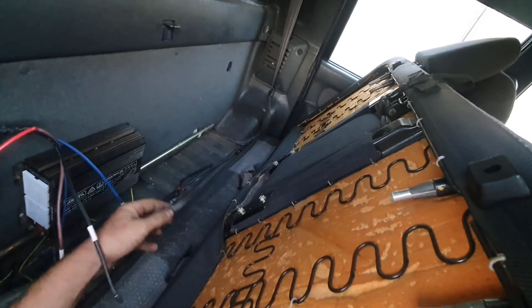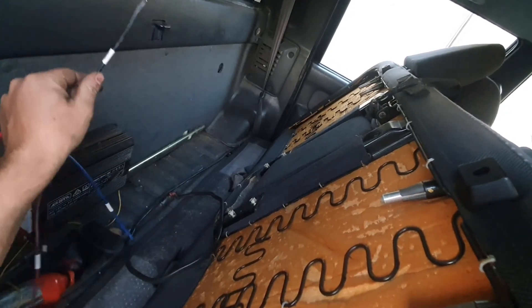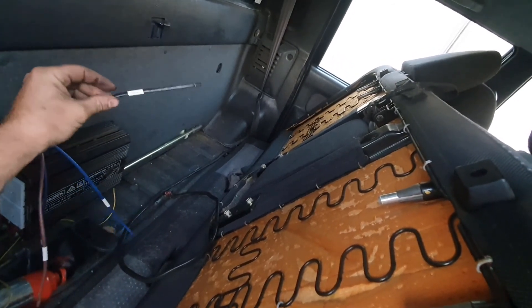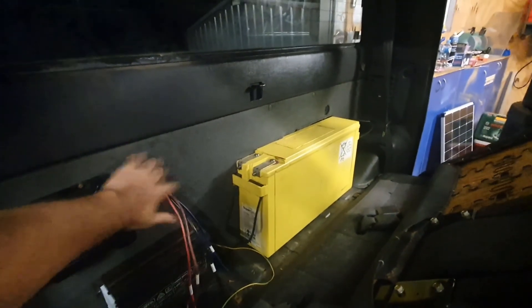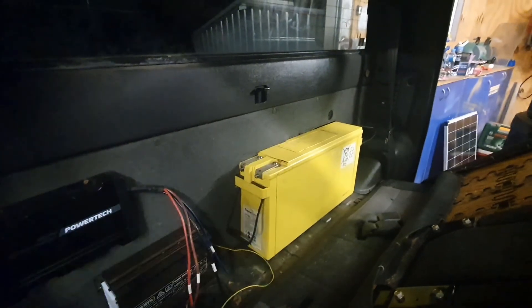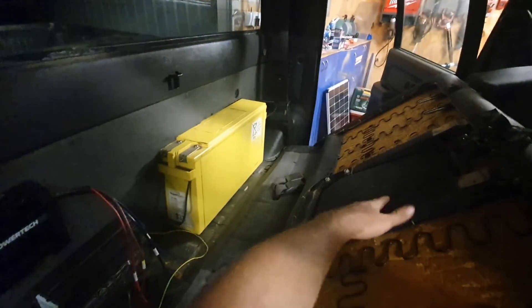The negative will probably go onto the battery and then we'll go from there onto the body, as well as this onto the body, because this is the ground for the unit. We chopped a little bit of this backing ply out around for the battery and now the seat can close. The inverter had to be moved - it was a little bit close. The seat closes and locks in - excuse the dog hair - there's the battery, nice and stealthy.